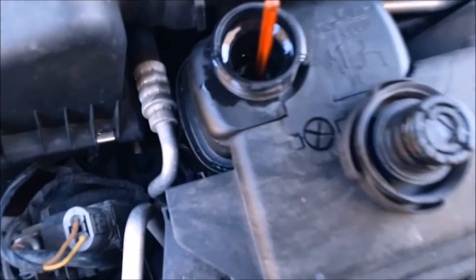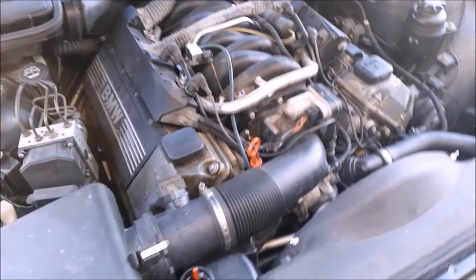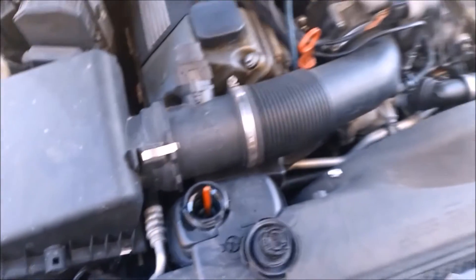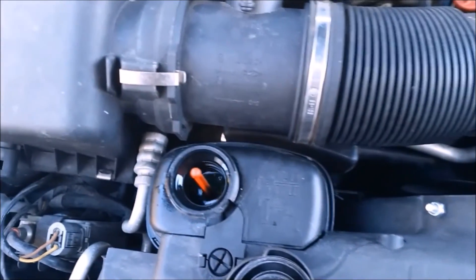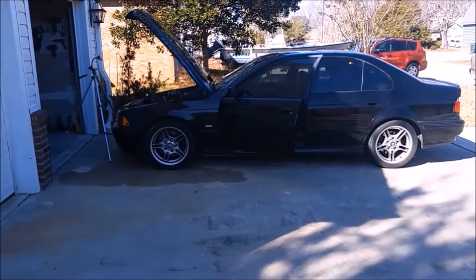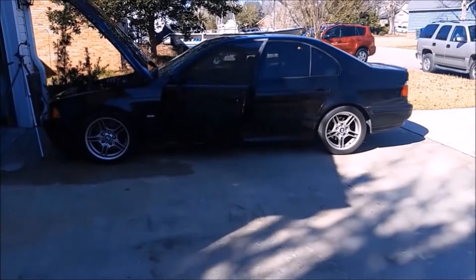I've got the car running now — it's a little high right now but that'll go down as time goes by. I'm seeing bubbles start to come out. I'm keeping an eye on the temperatures with an OBD2 reader; I just want to see if the fan comes on. The car is only at about 115 degrees right now. I'm periodically squeezing the hoses — you can see it kind of helps run some water through. I want to try and squeeze all those bubbles out. My driveway has a slight downward angle to it, which should help with the coolant; in a little bit I'm going to back it down so just the tail is in the street to give it an even more angle and help get some more bubbles out of the coolant system.